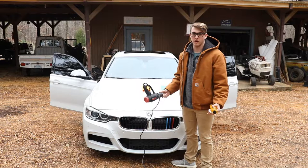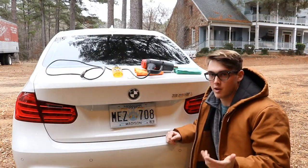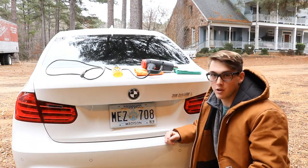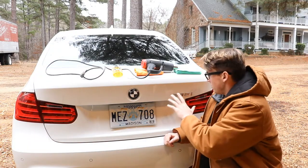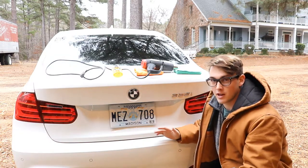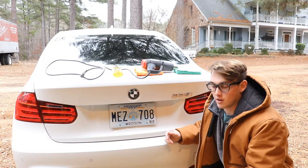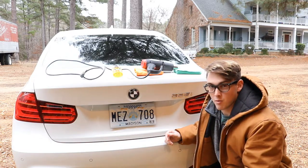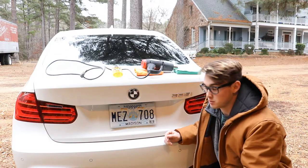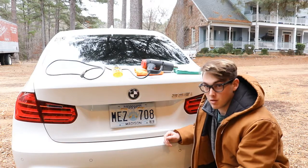The heat gun you don't have to have, but it's going to make it a lot easier for the adhesive and sticky stuff, so that'll make it come off a lot easier. Now we're at the back of the car. The first thing you're going to want to do is get your heat gun and heat up the emblem, because if the adhesive heats up it's a lot easier to deal with using the floss. The important thing to know with the heat gun is that you don't want to be too close, because you might tear up your paint or it might bubble up or chip off a little bit. So further back and just moving it all over the place is a better idea.